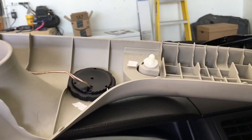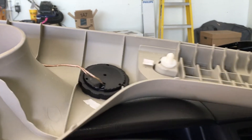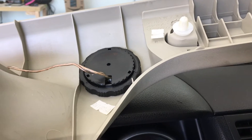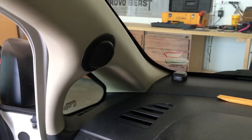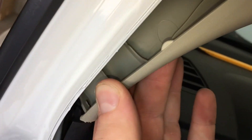The way these tweeters mount — you drill a two-inch hole, stick the tweeter through, and there's a large nut that fits around the tweeter that tightens it down. That's how I put that in there. Once you get yours in, go ahead and work it back on, make sure it all clips okay and is seated properly.